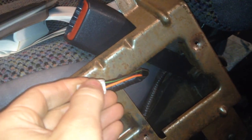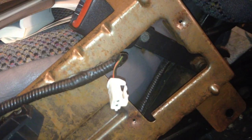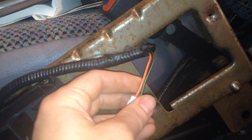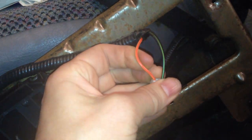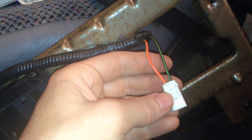I still have to do it to the other seat belt connector going to the passenger side seat. So what I'm going to do here is the same thing — I'm going to cut these two wires. I'm sure I probably could have bought another connector and brought the blue wire and ground into the connector, but I didn't do that, so I'm just going to use some wire nuts for the time being. This orange and red is your 12-volt power, and the green and black again is your ground. I'm going to go ahead and cut these off and connect them back up.